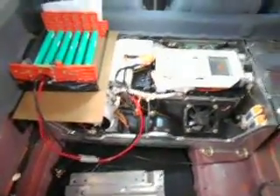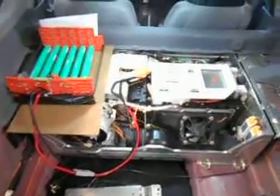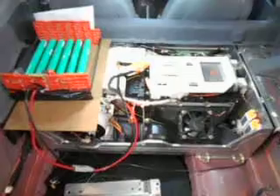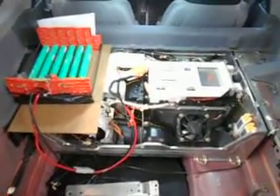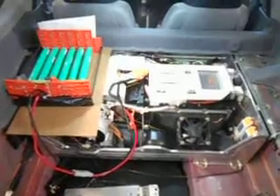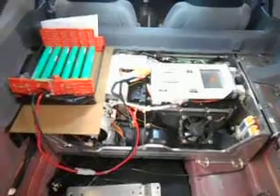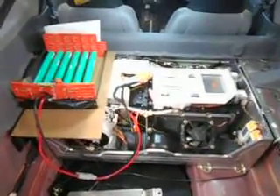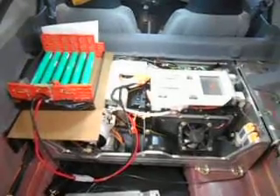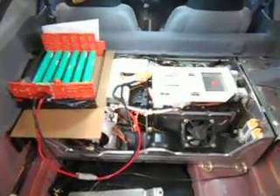I've been up the road in it and no other errors. Obviously the DC-to-DC converter is not working because it's out of circuit, but we saw 170 volts at 120 amps with the current hacking operation — that's over 20kW, which was pretty impressive. I also tried it without the current hack and that was giving around 90 amps at about 180 volts, so a pretty similar sort of power output.